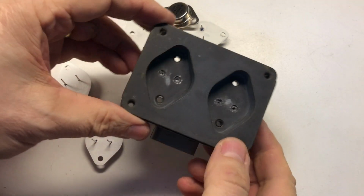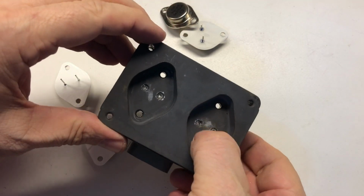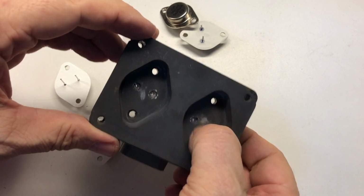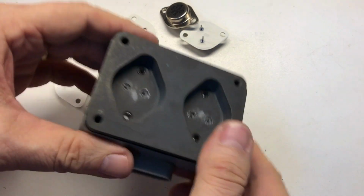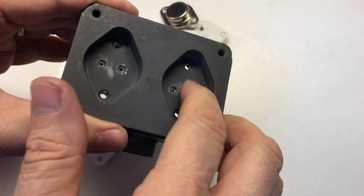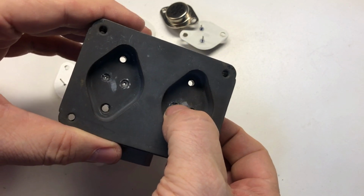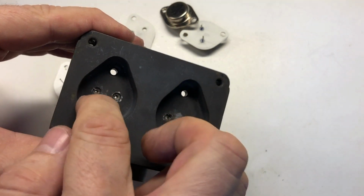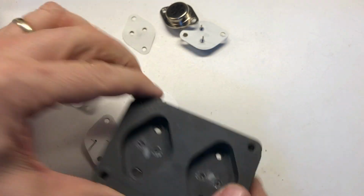All right, guys, we got this cleaned up. We ended up having to get a soft plastic scraper to get some of this residual thermal pad off. We want to have it as smooth as possible for the new pad. Also, I noticed that this coating that had dripped through where the solder pins go had raised the surface slightly, so I took a pick and chipped it out. It didn't heat anything up here. I just chipped it out so that we don't have that bulging anymore.